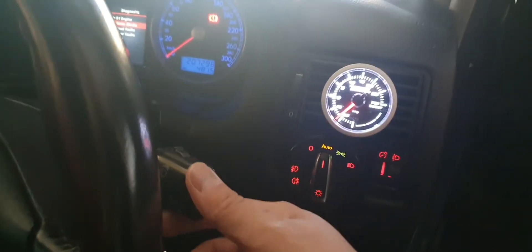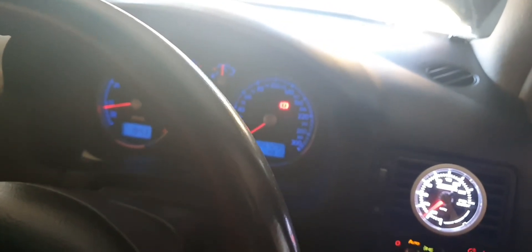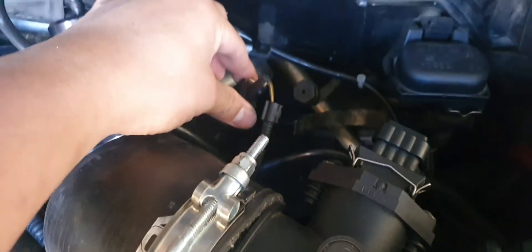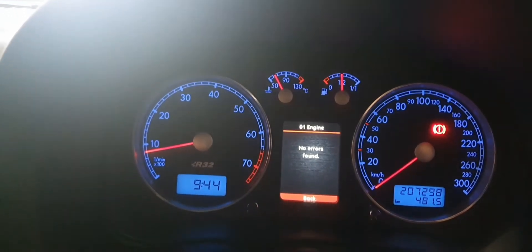Vacuum is spot on again — between minus 18 and minus 20. It's in fault mode — two errors: engine speed sensor, which I just replaced, and N75. Why is that open? Let's clear it and see what comes back. Something wrong with the N75 valve — it's not connected. Now it's connected. Make sure there's enough slack. I should be able to clear this fault now. For those who don't know, I'm using Color MFA to connect up to the ECU — one of the best mods ever. Fixed it on the fly. No more errors.